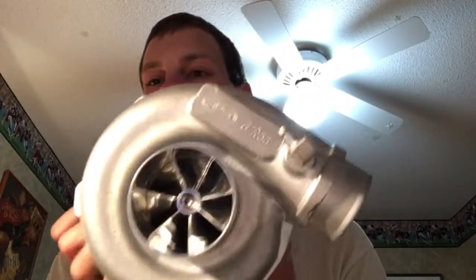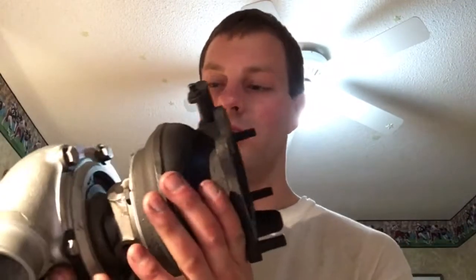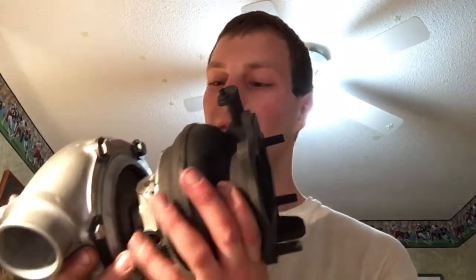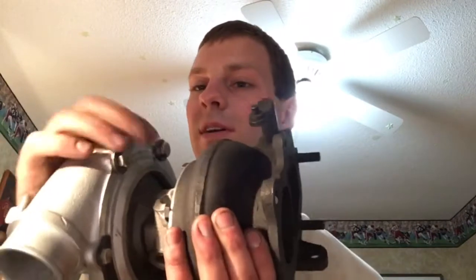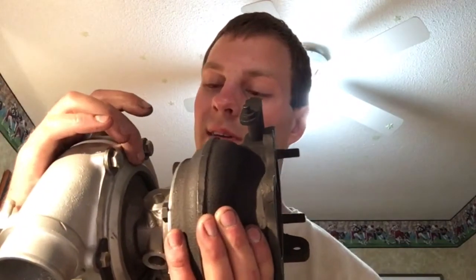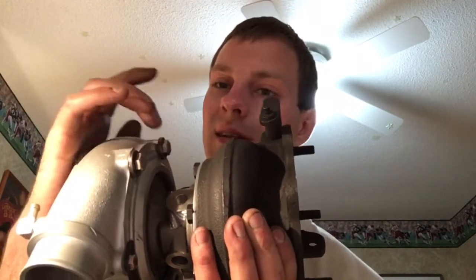That's how I did the whole compressor wheel upgrade for this one. I'll tell you how hard this was to do — basically this has to be symmetrical. The plate has to be symmetrical and the housing. I got the housing symmetrical, and the plate is a really tight fit from the way they send it to you because they want it to be airtight. So what I did was I machined it just a little bit so that it wouldn't be a press fit, and then I put a K03 compressor housing O-ring between this piece and the housing, and I machined this plate to accept that O-ring.